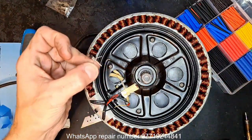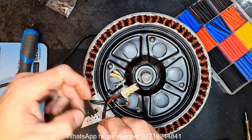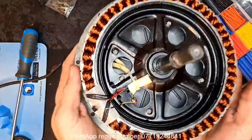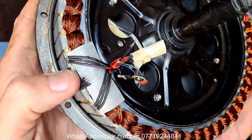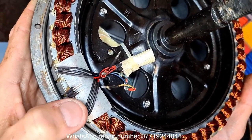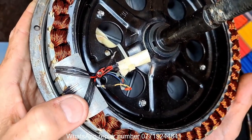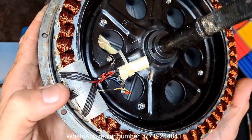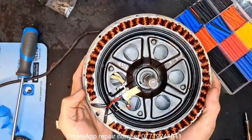I can't remember what I used it for, but there was one that was different. So we can just use our mock-up we did then, and obviously this leg, the furthest leg over. First leg is our volt, that would be our 5 volts. The middle would be our ground. And the last leg would be our yellow wire, which is our signal return or pin out.